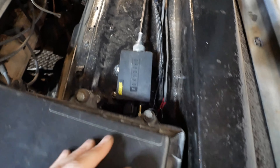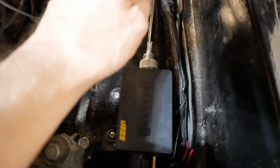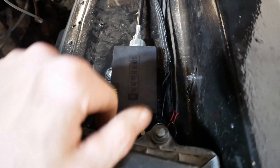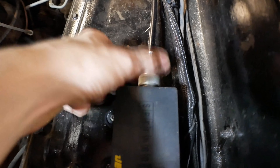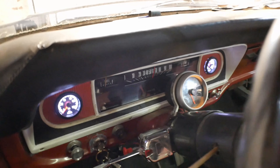The speed box is mounted right here. I've got the switch run down here in case it ever needs to be calibrated. Cable routing is pretty simple — one wire coming from an ignition source up in the dash for general wake-up, another from a battery fuse box for a constant trickle charge, and one for ground. That's all the wiring for the speed box. Then I've got the speedo cable — this is the old-style Ford. If we key the truck on and press the button, you'll hear it turn on — and then the speedometer should be at 60 miles an hour. And it is. That works really darn well. Very happy with that.